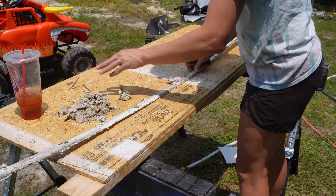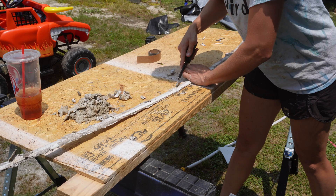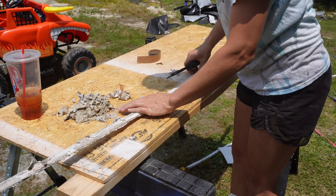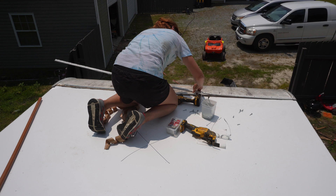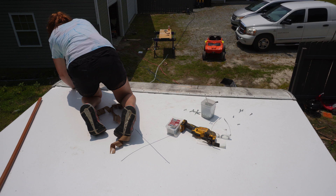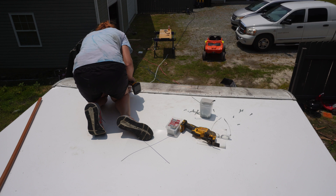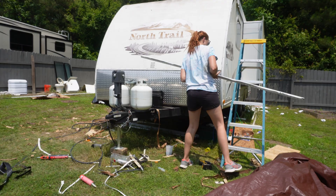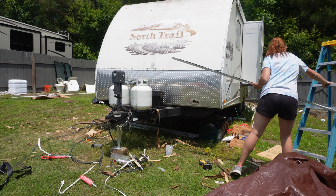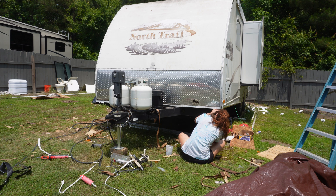Now that the two side pieces are in, I start working on the middle trim piece. Not only are you going to scrape the butyl tape off the back, you're going to scrape all the old caulking off the top of it — especially because this is a high water area. I want it as clean as possible. You won't get it perfect, but just do the best you can. I start on one side, line it up, put a screw in the middle, one on the other side, then fill in everything in between. Obviously put new butyl tape underneath this as well. Your layers will basically be: trim piece, butyl tape, front cap, butyl tape, and then roof membrane. That's how I like to layer it. If this camper had butyl tape under the front cap originally, I don't think it would have leaked as bad — so keep that in mind.